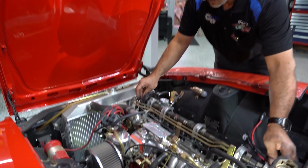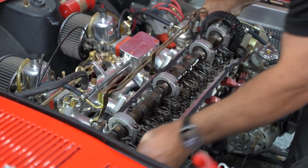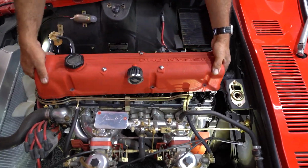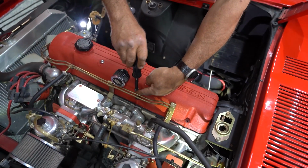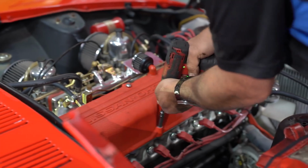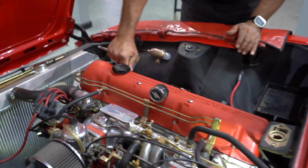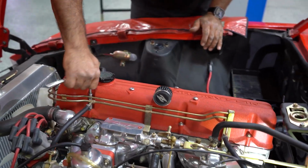But when you're doing a good inspection, you got the valve cover off, take a look at it. And this gasket was put on properly because there was no glue used. So that way it just comes right off, you throw it away, you have no surface you have to clean on the valve cover gasket itself. Place a new one in place, put the valve cover on top. There are no half moons, so there's no reason for glue.